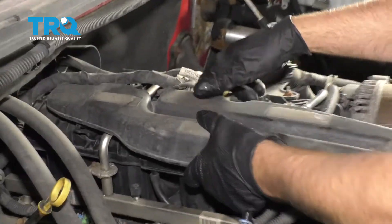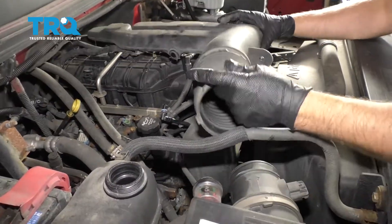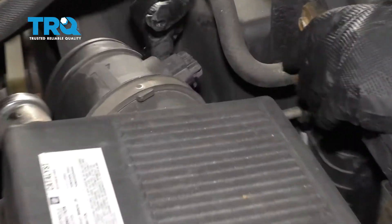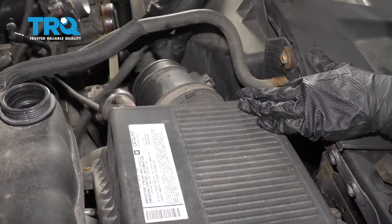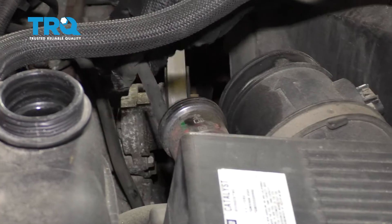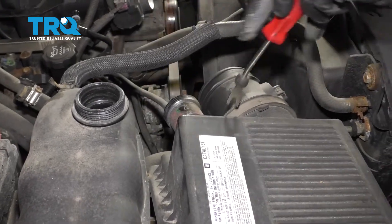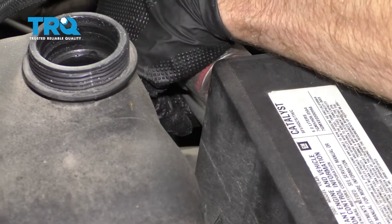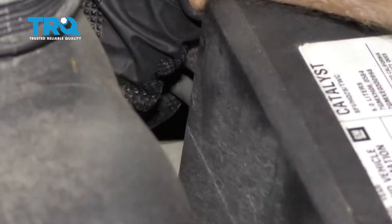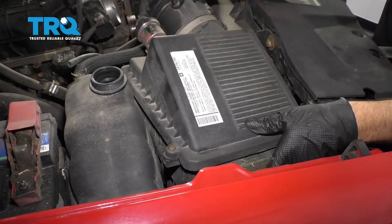There's a little grommet right here, so you just lift up on that so it comes off the pin and slide it out — it's just gonna come up like that. To give us a little more room, I'm gonna remove the air box. Just disconnect the mass airflow sensor by pushing down on the connector. On this vehicle, there's an extra hose that goes from the intake to the air box; take that off using some pliers or a prying tool. Set that aside, grab the air box, and just slide it up and out.